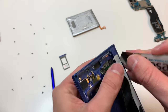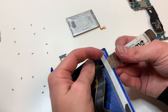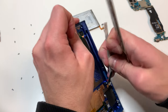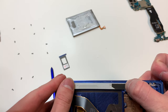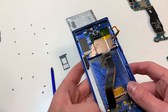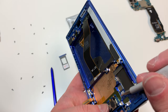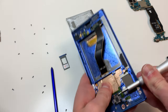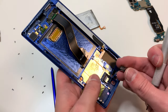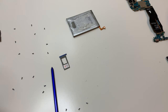But if you do need to move the S-Pen housing, I recommend removing this little plastic piece right here, starting at the bottom and cutting through the adhesive going all the way to the top. Then you just put it on to the new phone — make sure the adhesive still looks good, line up the top, line up the bottom, and add some pressure. The power buttons are generally in the frame, so the last thing you would want to move is the loudspeaker right here. All you got to do is pry up right here, make sure it doesn't separate, and it should come out pretty easily. Then just set it back in the phone — you might need to add some double-sided adhesive, but normally it should just set back in.